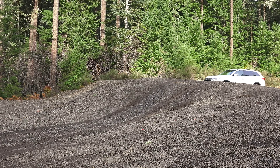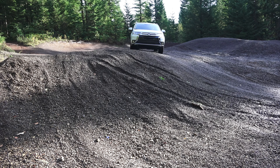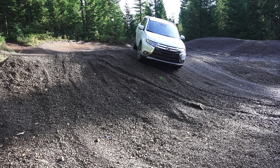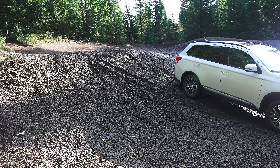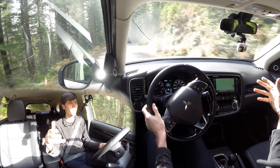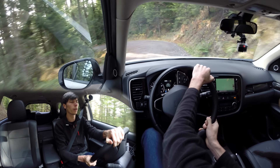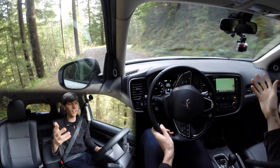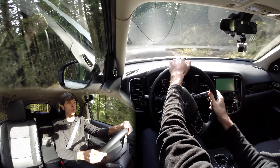I have to give it credit — pretty cool. Overall I've been pretty impressed with the all-wheel drive system. There haven't really been many scenarios where I've been able to trip it up. There was one example earlier this morning where I was backing up that same hill and got one of the rear tires up in the air — the front axle didn't have quite enough grip and was just spinning, and with one rear tire in the air and an open differential it wasn't able to put down much, so I wasn't able to go over the hill in that situation. But this is on all season tires — put better tires on it and I'm sure it'd be pretty capable. For the vast majority of drivers who aren't going through snow, mud, and steep inclines like this, the all season tires are going to do everything they need. For those who need a little more capability, put some better tires on it — the all-wheel drive system itself seems to be pretty capable.